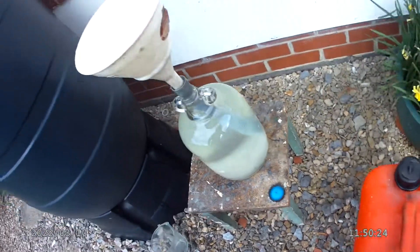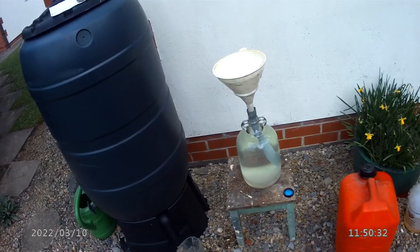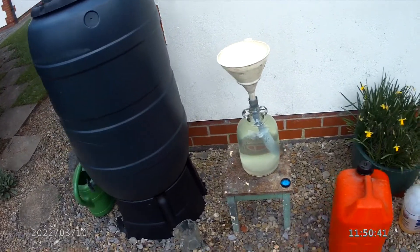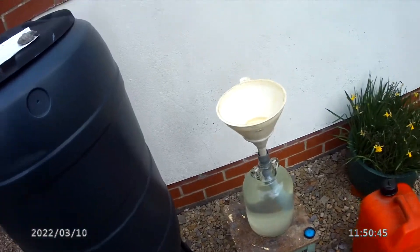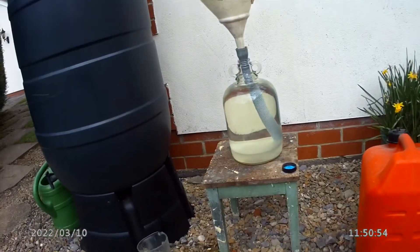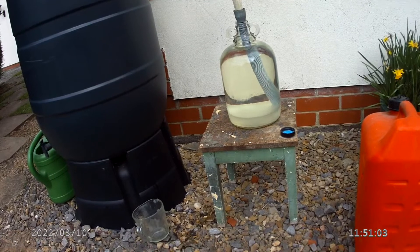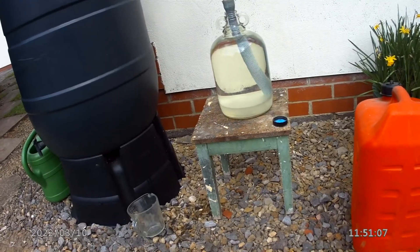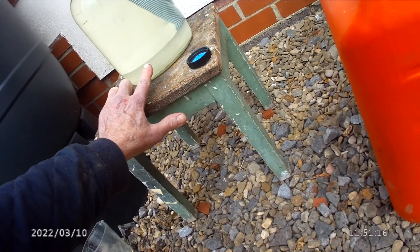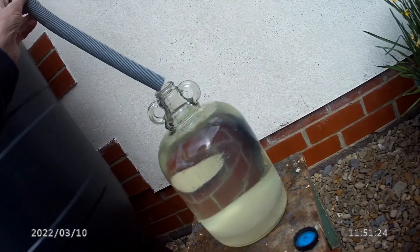People sort of say, well, why is it that ethanol dissolves in water? When you think about it, when you have a pint of beer there's a certain percentage of exactly the same alcohol in it. Another name for ethanol is ethyl alcohol — C2H5OH — and that's the type of alcohol that's safe to drink, up to a point. And you can see straight away that the petrol and the ethanol have stratified. So that one pint of water now contains all of the ethanol in almost a gallon of petrol. I'll just give it a quick shake up to be sure.